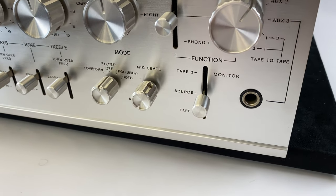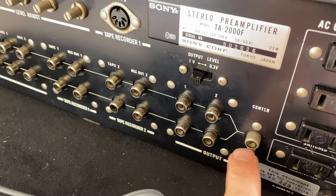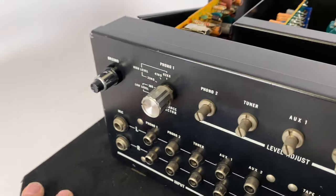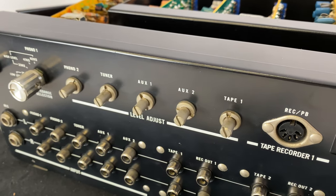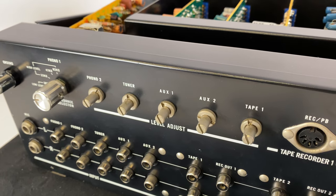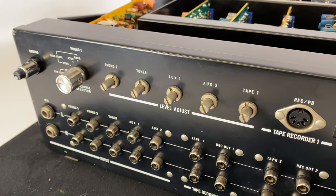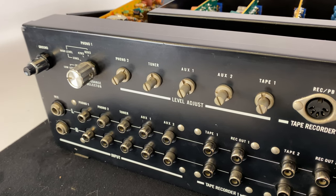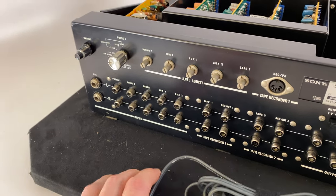The tape monitor works in a similar way down here. Let's take a look at the back. There's a center channel output for those of you interested in that. The standouts on the back panel are the adjustable cartridge loading for phono one, and then individual trim pots for each one of the other inputs. It looks like aux3 on the front and the mic inputs you can't trim. The reason you'd have this is if you wanted to balance your levels so that each source was coming in at about the same level, so that when you adjust your volume control or switch between sources there's not a big jump between a hot and a less hot source.